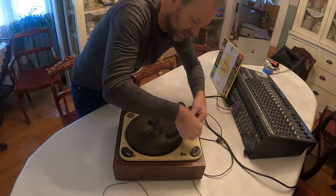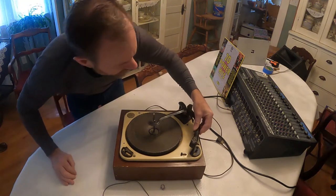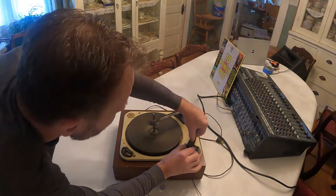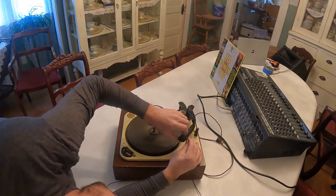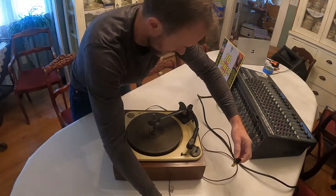The first thing we're going to do is take this rubber band off, because that's keeping the needle from flinging around and damaging itself on these old units. You do want to make sure there is a needle — I can look under there and I do see the needle. I need to make sure the needle is turned the right direction, because they'll have one needle for 78 RPM and another needle for regular LPs. If you use the wrong one it can do a lot of damage.